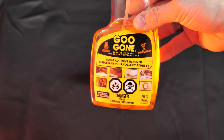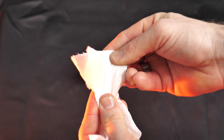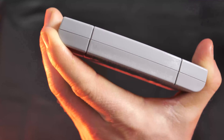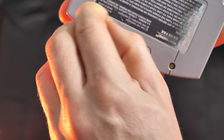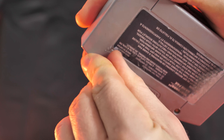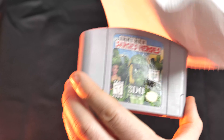If there's some residual glue, I like using Goo Gone to get it off — but be careful. Goo Gone is oil-based, so it's really good to get the glue off; however, make sure it's nowhere near your pins. When using the Goo Gone, spray it into the paper towel very lightly — you don't need a lot. Press it on a little bit and slowly make your way around the outside of the cartridge. For stubborn parts, use your nail and try to scrape it off as best you can along with the Goo Gone. Then take a final clean paper towel, give it all a wipe down, and go over it one more time with the Magic Eraser in case there are any spots that still have some residual damage.